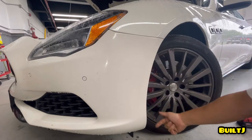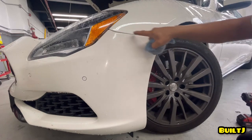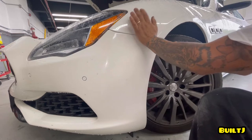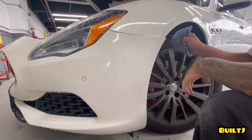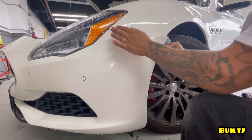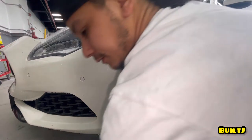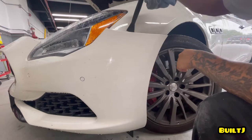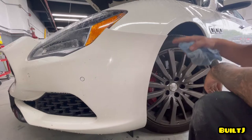Now that we've taken off the clips as well as the torx bit on the end, we're going to carefully remove the fender liner. You see the seam — I'll put my palm here and pull on this side so I don't pull too much. There's just a bit popped out there. You want to get in a little bit more and slowly remove it. You can also use a trim clip tool if you have one small enough — this one's a little large — so carefully just pry it out and you'll be all set.